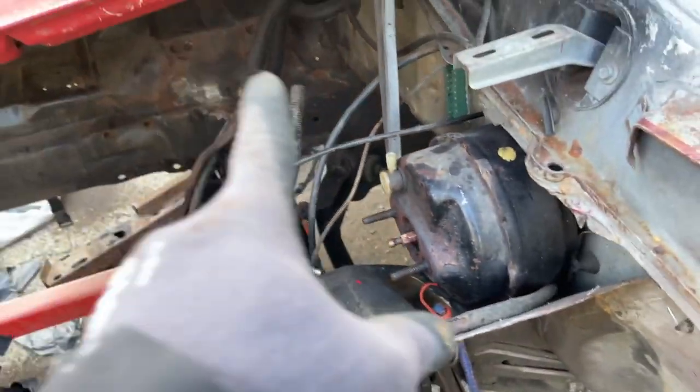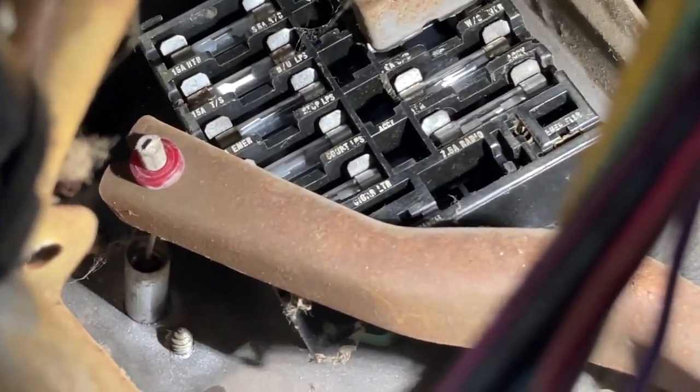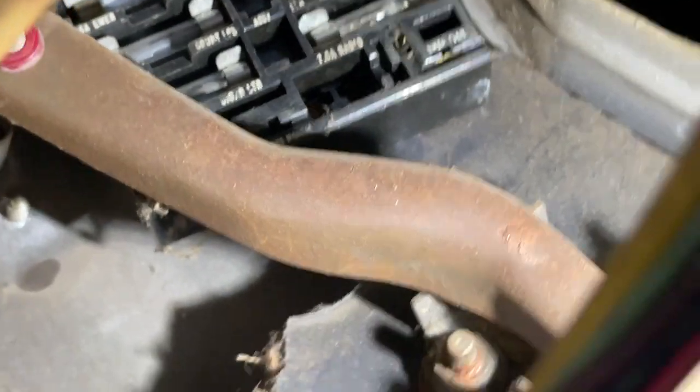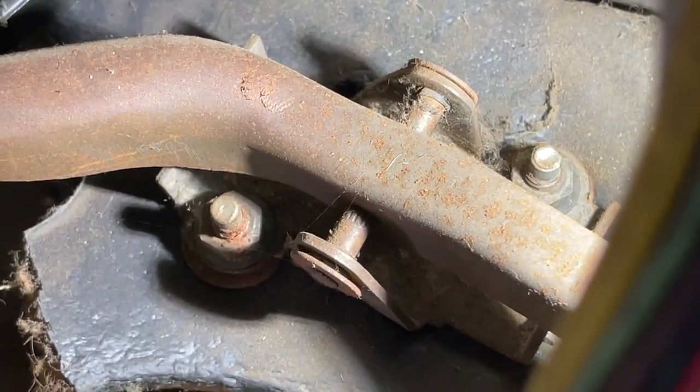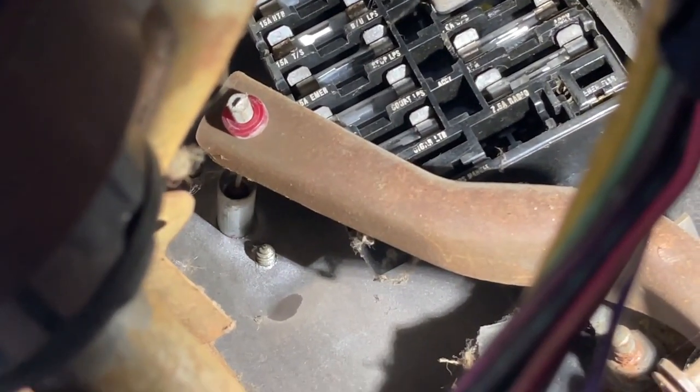The difficult part of replacing this — if you look, we got another cutout here. Look at the steering column brace, that metal bracket that the steering column sits in. It houses the brake pedal — I've got a video for that on my channel. But if you come from under the dashboard, without taking that pedal down, it's very hard to reach up in there and remove that plastic part. So this pedal has to get dropped down. You have to take the pedal down in order to have access to that plastic washer the cable sits in.